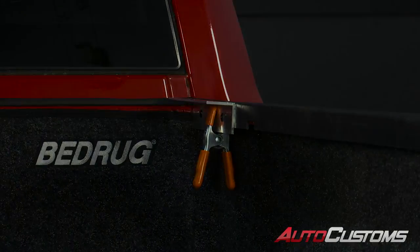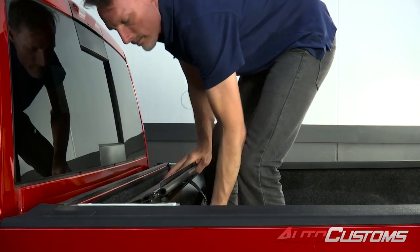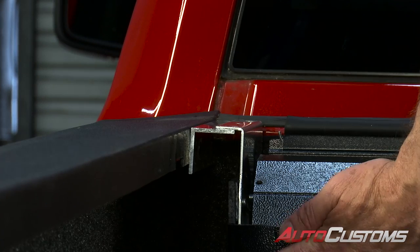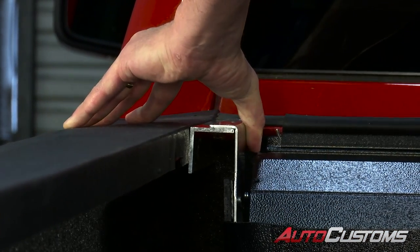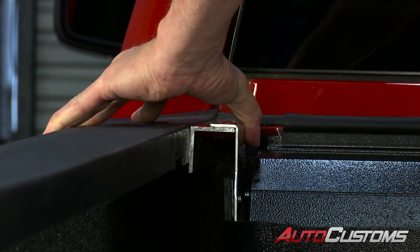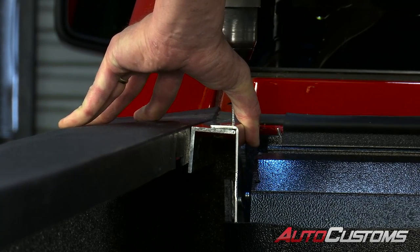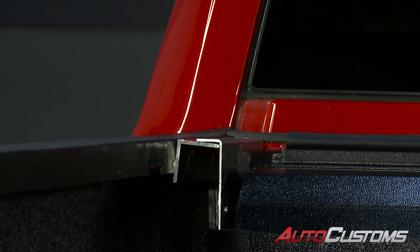We're going to do that on the driver's side as well. Then take the canister and position it right on top of the hanger brackets. Before fixing the canister to the canister bracket, push the canister all the way up to the bulkhead and pull the bracket all the way onto the canister bracket, then use a provided self-tapping screw and go through the hole in the center of the bracket. Repeat the same thing on the passenger side.